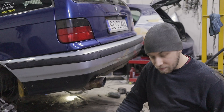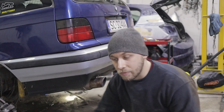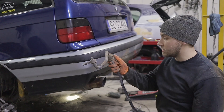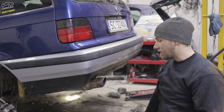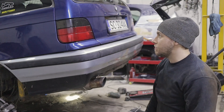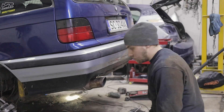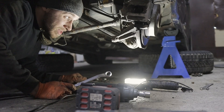It's beyond repair, so I think I will reuse the other part of the suspension I have. It's going to be a bit longer project than I anticipated. I also took out the sway bar — bushings very bad as well, one broke. Every bushing in this car needs to be replaced. I wasn't planning on doing that because I really want to finish the Astra, but it was just too dangerous to keep driving the car. Old cars — but the parts are cheap.